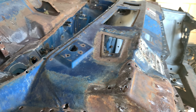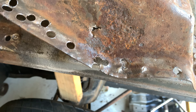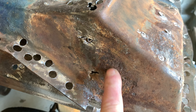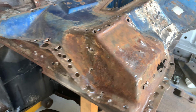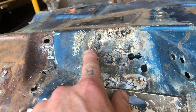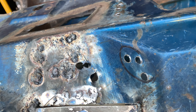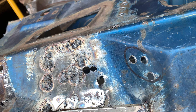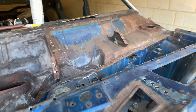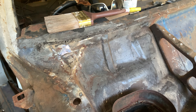So I have started - this looks like Swiss cheese now. I've had to drill it all out. I've got to replace, probably steel plate that, cut that out, steel plate that, start to steel plate that and fill up some of the holes. Get that sorted, and then I think I'll cover all underneath and reseal under there, then weld the plenum back onto it.